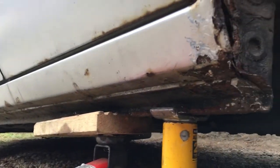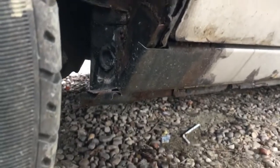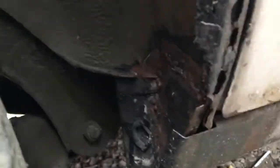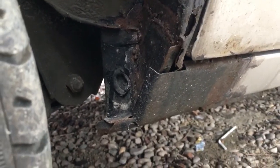giving them a repaint. Now, last year the reason I took her off the road is because I started doing this welding at this side, so the same basic repair, but it was a lot worse. And you can see I had to do a much bigger patch, and I got so far, as you can see, and then I left it, and there was a patch on the inner end of the sill, plus the end of the sill itself was really quite badly rotted.